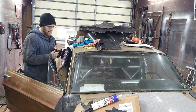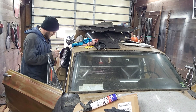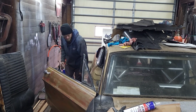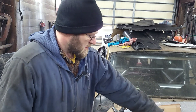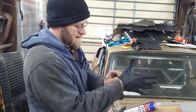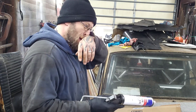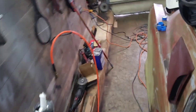I'm going to blow around the floor joints there and get the dirt and stuff away from them. And I've got to seam seal it. Most of the dirt is out. Let me get a glove on. I've got my seam sealer here, and I'm going to put it on all the welded-up floor joints. I'm going to put it on the side of the line here.